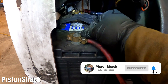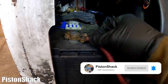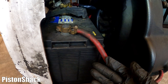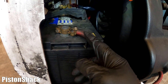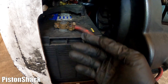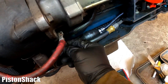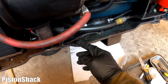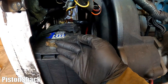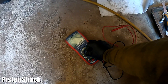The red wire from positive is going to the starter main hot terminal over here, the top of the solenoid. Everything is nice and tight, nothing loose, no serious corrosion. Here's our negative wire - nice and clean, tight on both sides at the connectors and the clamp. It's a negative ground wire - red but it's the negative - coming to the engine ground, nice and tight and clean. This is also the body ground and engine ground from the battery. Let's go check the battery voltage.